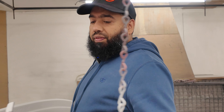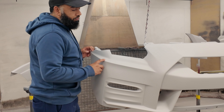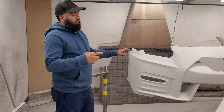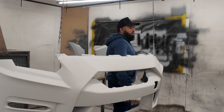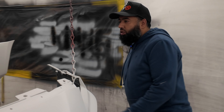I had to take the bumper off and strip it all down as the car was previously wrapped and we never painted the bumper. So I needed to plastic primer and 2K primer the bumper — that's what you see here. Everything else is just 2K primer because they're BRP parts.